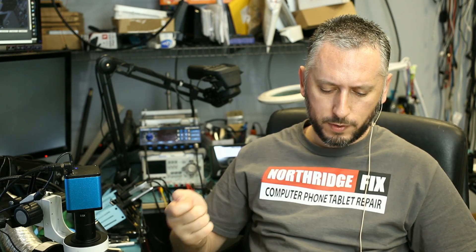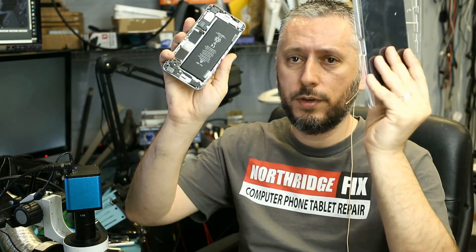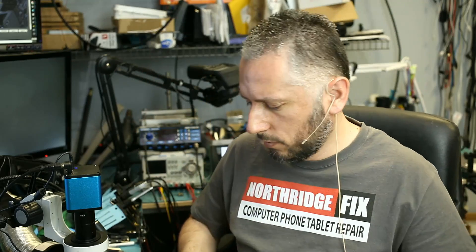We just got a package from Utah. The customer's name starts with C — I don't say last names on camera. It's an iPhone 6s Plus with the touchscreen not working, needing a screen replacement. There are also missing filters — a very common issue with the 6s Plus. When you change the screen, you can end up ripping components from under the FPC connector. These components are extremely tiny; people who pry screens with their nail or sharp objects can tear them right off the board. The customer sent a screen and an already-open phone, so we can go directly to the repair.